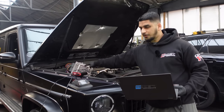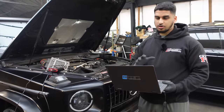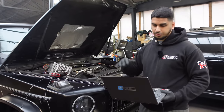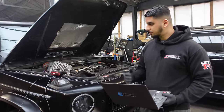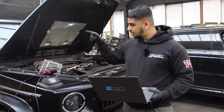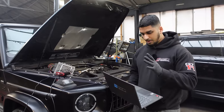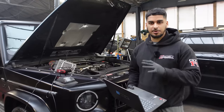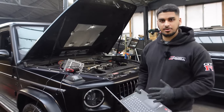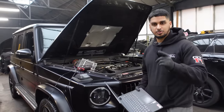I've now taken the stock file read of the car — the stock ECU information onto my software. I'm now going to tune it. I'm going to let the ECU know that the catalysts are now missing and also up the boost, which will allow us to unleash the power to about 750 horses. How custom tuning works is: once you put the tune file back to the ECU, you go for a test drive, do the logs using the laptop and software, make sure everything is working perfectly fine, and then fine tune it to get the optimum results. At the end of this we're going to have a very fast G63 AMG running 750 horses and around 1000 Nm of torque — not to mention very loud pops and bangs on the exhaust.